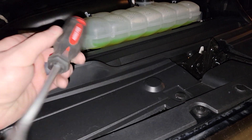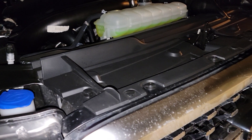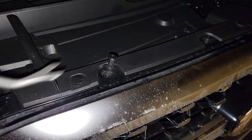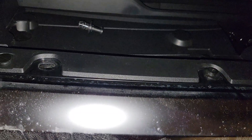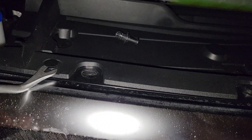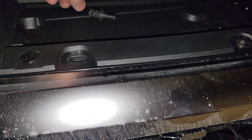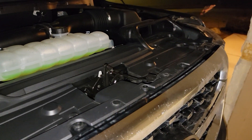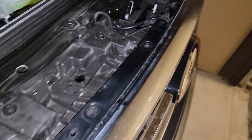So I've got my Nikko Pro panel clip remover tool — I've got six of these, it's a complete kit. It's really simple: just pop that in there, lift it up, and just like that. This piece is pretty similar — pretty sure it's identical to the previous years, so if you've taken one of those grills off it's the same concept. I'm not gonna show you all of these, I think there's like 20 or so. I pulled off the top piece, just popping them — I'm gonna pause this, get that pulled off, and show you what it looks like underneath. Alright, so I've got the cover off.